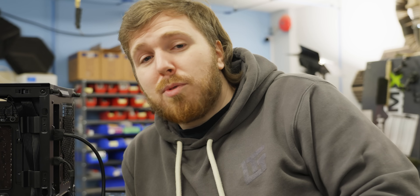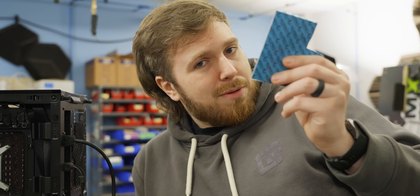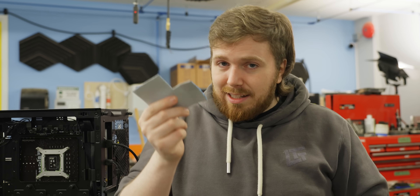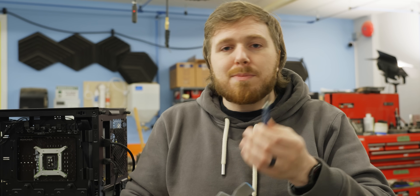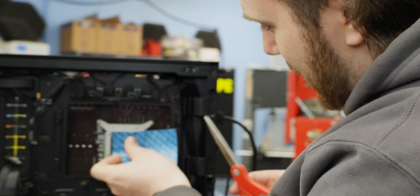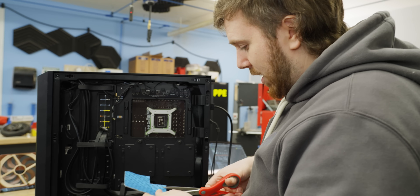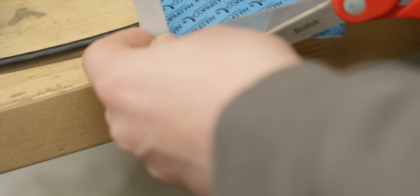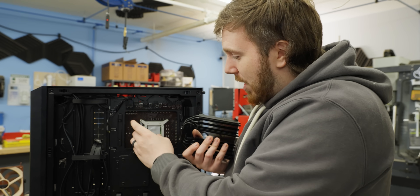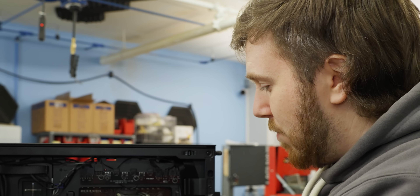What are we going to do about that? We're going to need a cushioning layer that's a lot thicker than typical thermal paste — like a one-millimeter pad. Sadly, it has worse thermal conductivity than any thermal paste, but it's much better than air, which is what the fan is working with. We decided to go with a mechanism that mounts into the corners already part of the Intel bracket, because it just makes our lives easier.